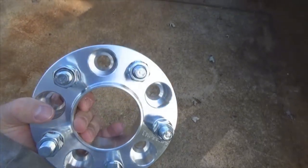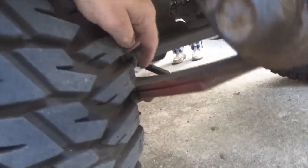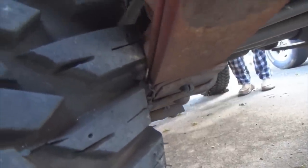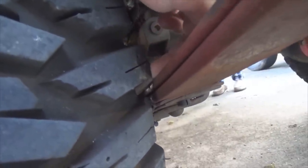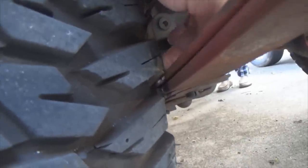All right, let's get a wheel pulled off and check them out. You can see right here where the steering wheel is at full lock. It's not really full lock, it's just the point that it has now contacted the springs. You see how this lug here will hang up on the leaf. That's not really the worst of it. Let's show you the backside of the tire.